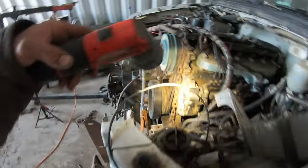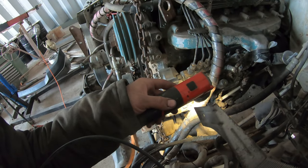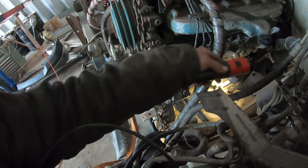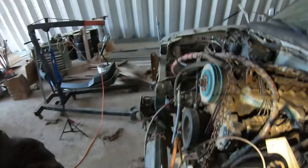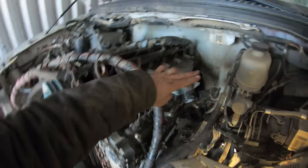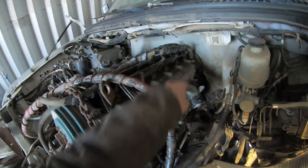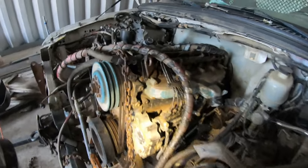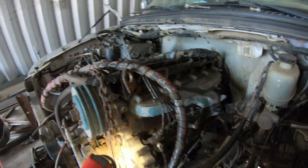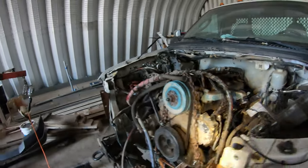It's as far ahead as I can go right now. I've got about a half inch to an inch on the pan from the front of the low part on the pan to the cross member, and I've got about two fingers — about an inch — at the back of the motor from the block to the back of the firewall. So it fits in there. It's just that the block is really tall and the transmission sits up really high on the block — those are the only tricky things.